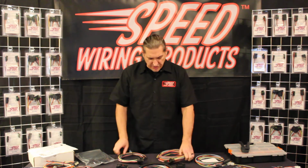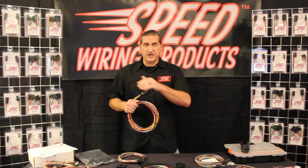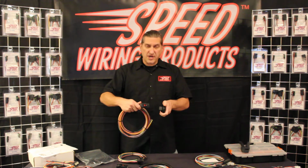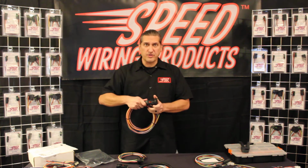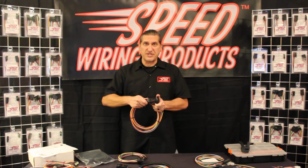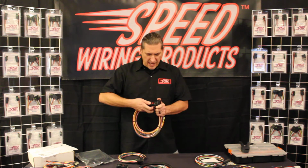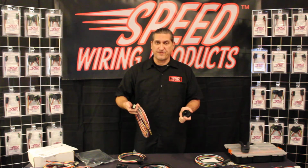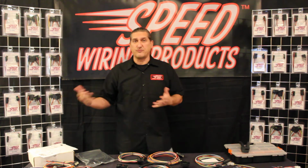Once that's mounted in your system, now you're ready to mount and wire the connector for the inside of the engine compartment. To connectorize these, all you do is line up the main tabs, push them together real tight. You'll hear an audible click. Then you engage this locking tab. Now your connector system is tight, it's not coming apart. In order to get it separated, pull back on the tab, depress this button really hard, and you can disconnect it from your firewall. Now, anything in your engine bay, your engine itself, can be disconnected and removed very easily.